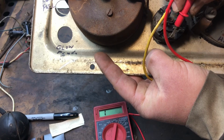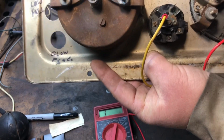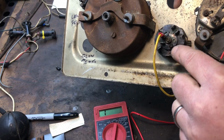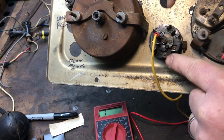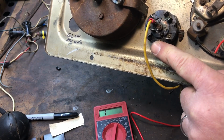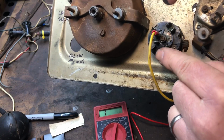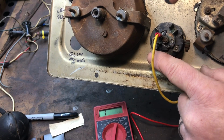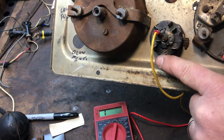Marker light, this one turns off completely, so that must be the reason why, because it's an American truck, maybe? In the American market, for some reason, you have your headlights, your marker lights, and then your rear marker lights. So in America in the 60s, for some reason, whenever you turned on your headlights, they wanted the marker lights to turn off in the front, which also happens on my Volkswagen as well. It's an odd thing that they do, but I'm going to keep the markers on in my truck in the front and the rear. So I'm going to be hooking it up to here and not hooking anything up to this at all.